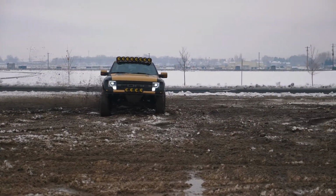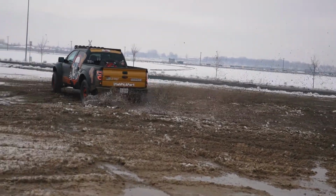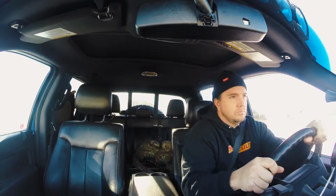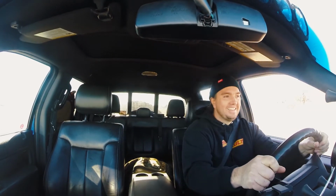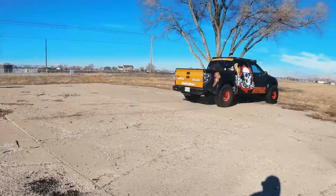And that actually, just so people out there know, is we didn't touch the rear suspension and it looked perfect. Stock rear FX4 F150 4-wheel drive with the Baja kits, and we did King coilovers, the 3-inch Kings in the front, remote reservoirs, and then we went with their triple bypass as well in the front, all first with stock rear end, and it sat perfectly level. It sat really good. From there we wanted to upgrade the rear suspension.